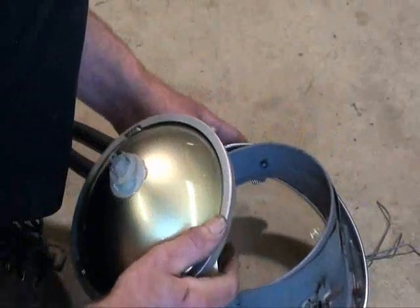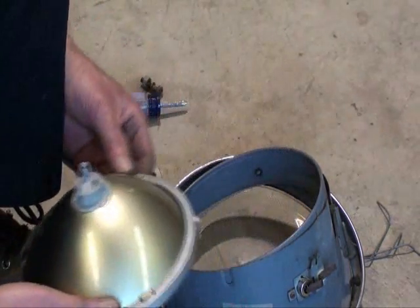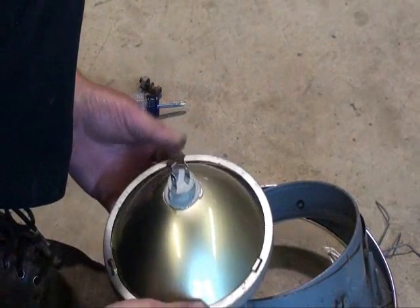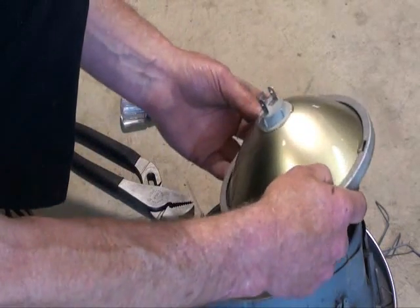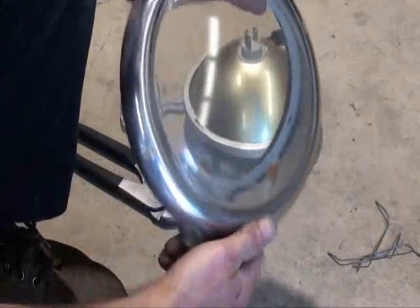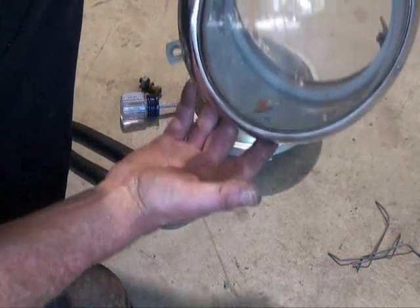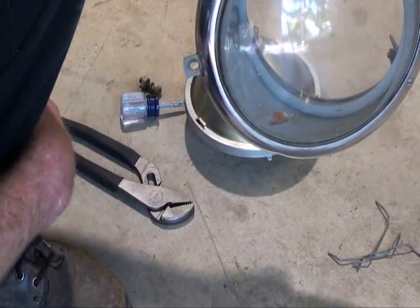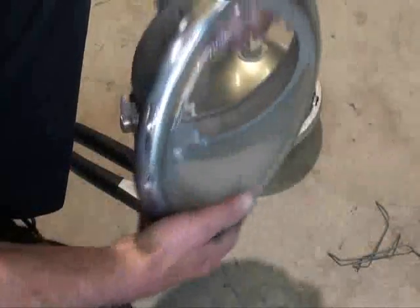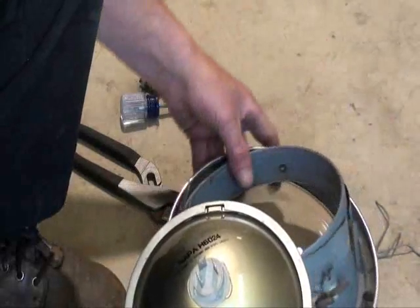There are little slots cut out here — there are actually three tabs on this one, two of them are bent sideways. I may be running bus headlight buckets here. The adjusters are different on buses than bugs, and I may have bent those tabs out of the way so I can orient my bulb correctly using this bucket assembly on a beetle. On a bus, working on the driver's side right now, the headlight would be oriented this direction with the mounting screw towards the center of the bus. On a beetle it's mounted this way. I have an idea this bucket assembly is from a bus, so I've bent two of the tabs out of the way and use one to orient the headlight in the bucket in the correct direction.